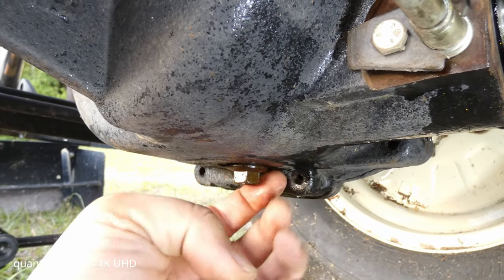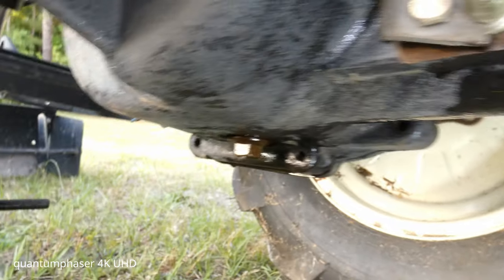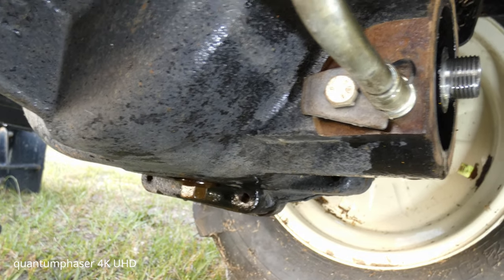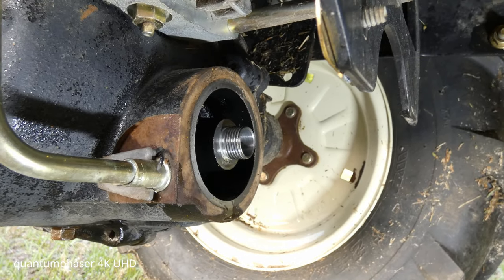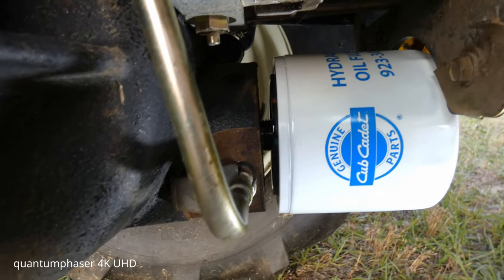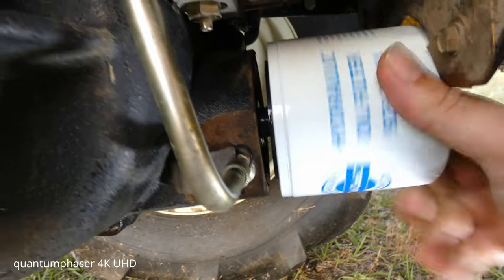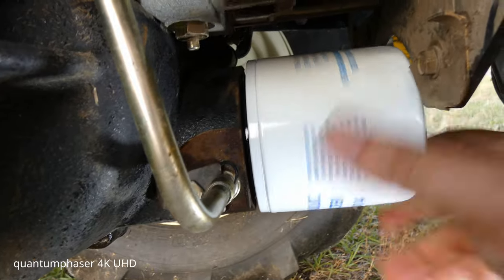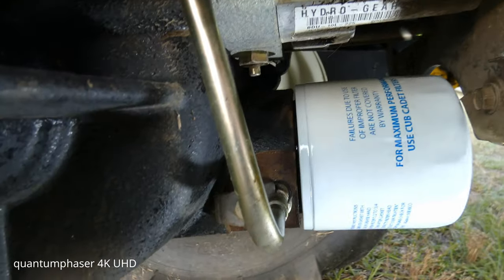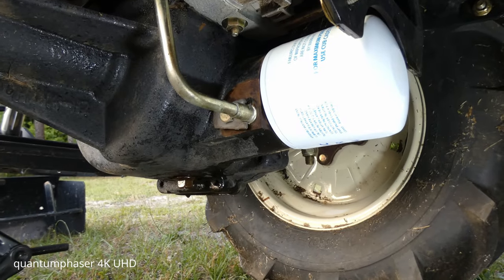I've already gone ahead and wiped all the debris off underneath, and the drain plug is already replaced and tightened down. There was no crush washer on it so if I recheck it later and there are leaks I could always add a crush washer. Let's get that oil filter put on there real quick so no contaminants go inside. The oil filter should be just hand tight - make sure you're not cross-threaded, go on there nice and smooth - and I'll give it an extra tightening when I put the camera down. Then we'll be ready to add the fluid.